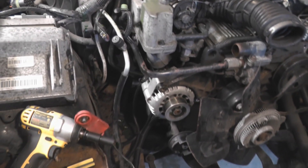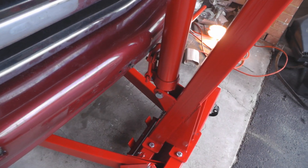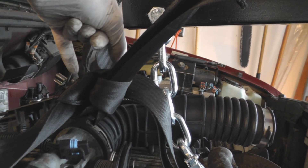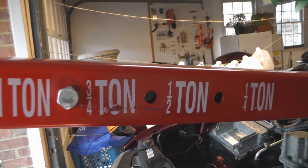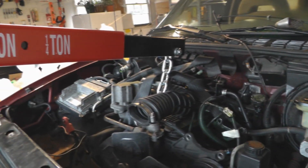What I think I'm going to do now is actually just attach the engine to my hoist, which I built the other day, and just start jacking. I just have stupid problems sometimes. As you can see, this is clearly touching the bumper right here, and up here this is mere inches away from the seatbelts it needs to be attached to. That means I have to go move this bolt up another notch, which means it can't hold quite as much capacity. It should still be fine — this engine does not weigh a thousand pounds, but I put it on three-quarter ton to be safe. Apparently that was a mistake.